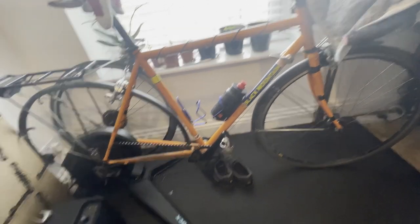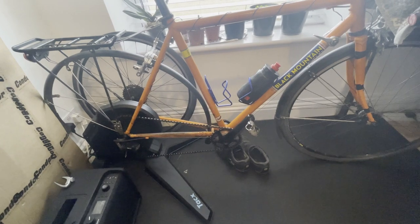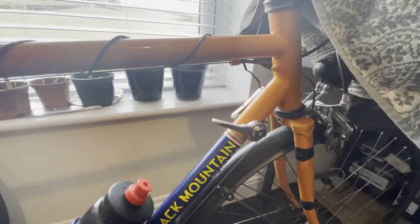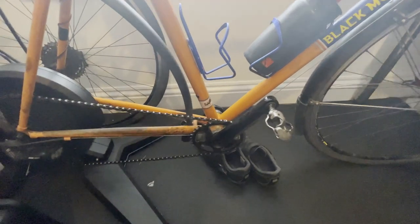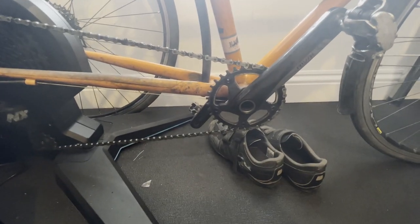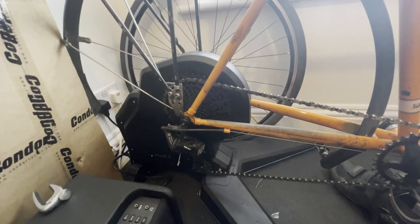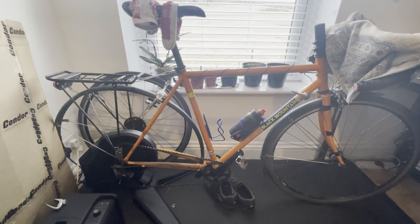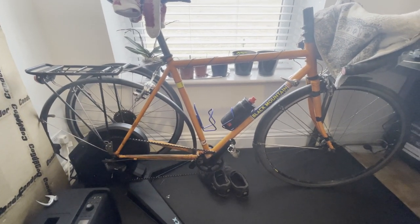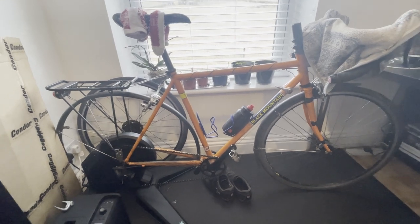This is the other alternative setup you could do with a one-by, and it'd be cheap — but this stuff is black, so I didn't want to do that on the conversion I just did. Friction shifters there, and this one has no cable on the other side because it's a one-by 11. Really small chainring up front — I've got Rival, I think it's a 30 or 32 — and then a massive cassette on the back, which is perfect for the hilly terrain around here. NX derailleur. This is what I mean: with friction shifters you can put on any derailleur, any cassette — it just works.